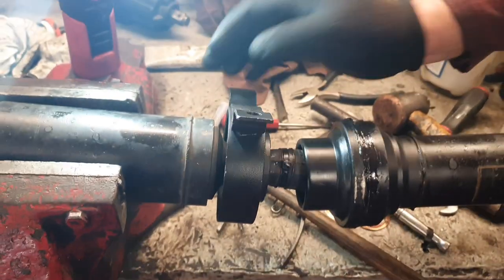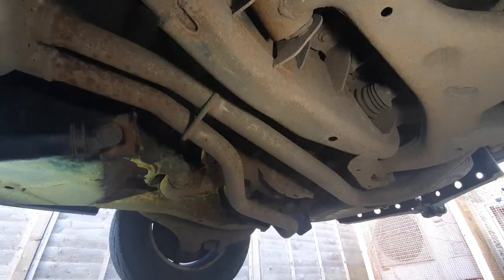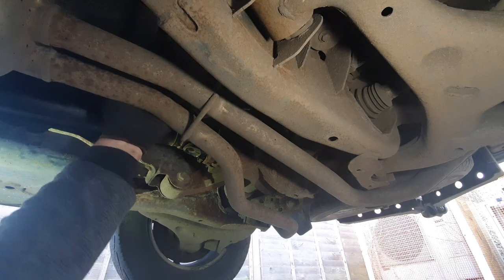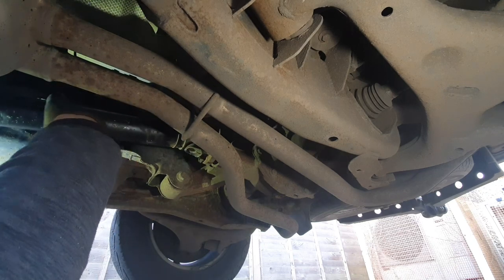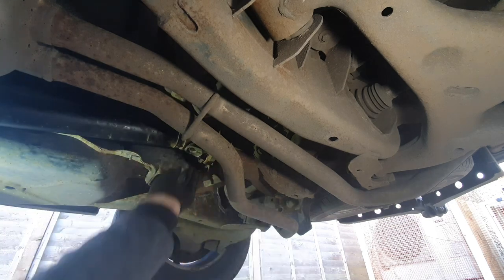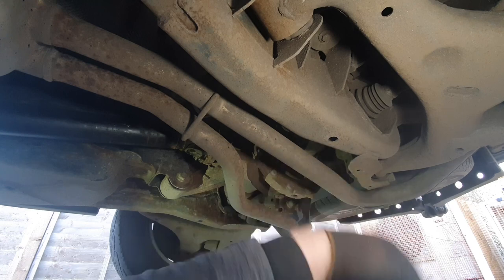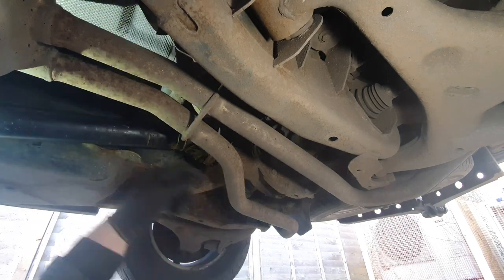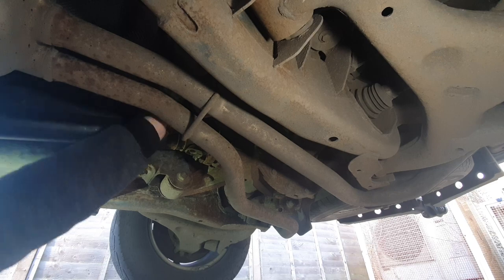Plastic tie back on the coupling cover and now we need to take it back and fit it on. Back at home underneath the vehicle, I'm going to start at the rear end and put the prop shaft onto the back rear differential. It's nice if you can have an extra pair of hands, but there's no need - you can use a jack or like I'm doing here, resting the other part of the prop shaft on my knee. I'm going to start a bolt by hand just to secure it so it's not going to fall off and knock me in the head or damage the prop shaft. Always best to start these bolts by hand - if you can get it in a few turns you know you're safe and you're not going to cross-thread anything.